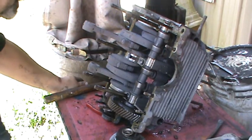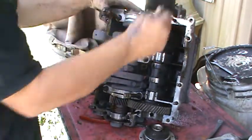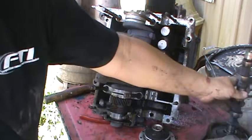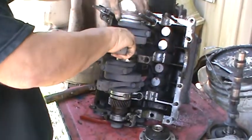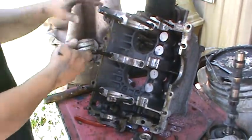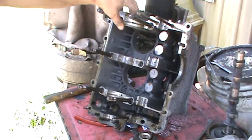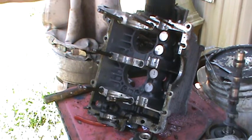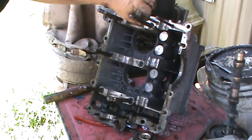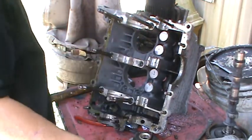The funny thing is the threads look good on the main stud — it looks like the stud just came out of the case. I've never seen that before. It's a flat cam, so it's a later one, and it has the four-bolt in it. I'm sure this crank will be good. The bearing has come out of the rear of it, so that's probably not repairable — they don't make a bearing with that big of a thrust on it. We'll take it down to the machine shop and see if he thinks he can put a thrust cut on it, maybe line-bore it and use it again, just because it's a bus case. The dowel pin seems to be compromised too.